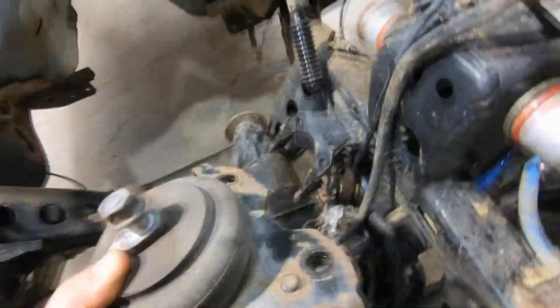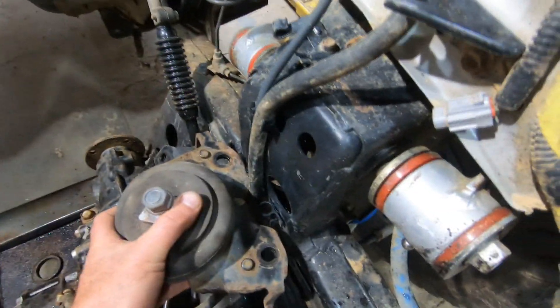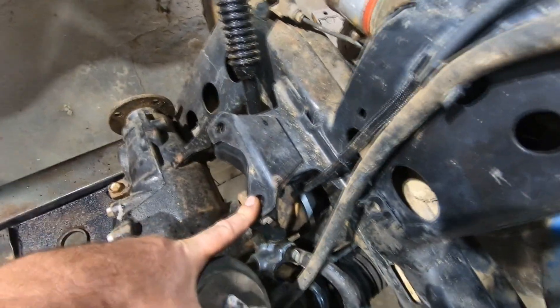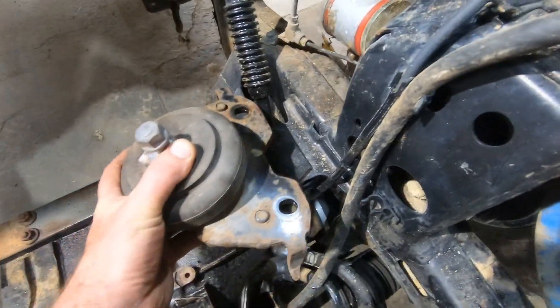However, I don't think they're going to fit. It depends on where this thing's going to sit, because in the Tundra these mounts were right in line with the shock towers. But in the Tacoma the brackets are slid back more from the shock towers, and that's where I'd like to keep my mounts. So if I am able to slide the engine back that far, these mounts aren't going to work because the mount is going to hit the steering shaft.